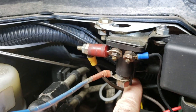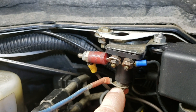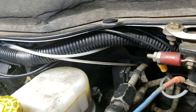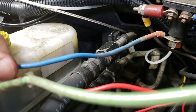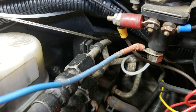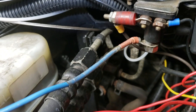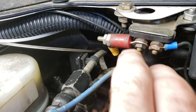We've come off the battery with a heavy-duty wire going to feed the back side of this relay — that's just how we routed it. On the other side we have a 10 or 12 gauge wire. We wanted it to be even a little heavier to give it overkill. We soldered all the connections and insulated them. So you just have battery to the back side, and when your solenoid completes the circuit it will flow from the battery through here.